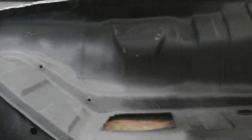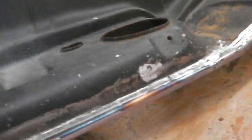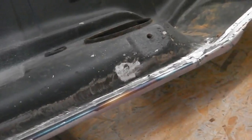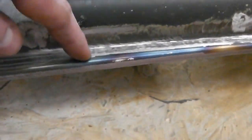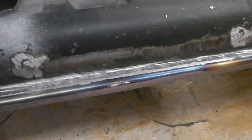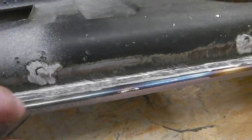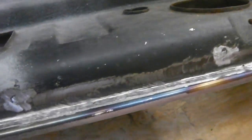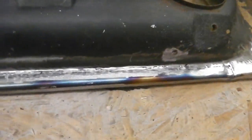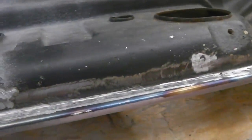Now, what this bulkhead did need is I had to fabricate a new lip edge for it, and we're halfway through finishing that job off. This lip here, by the time you've drilled, and there's loads of MIGs piled up all the way along, looked really messy. What I was initially going to do was try and tidy it, but the lip was damaged. There was a bit of corrosion on it, not much, but the way it was left outside the shell, it was an abandoned project. So I thought, if I can form a new lip edge, we'll butt weld it in.